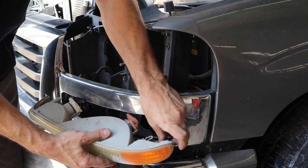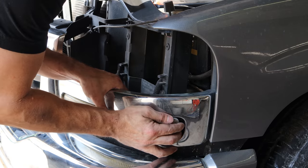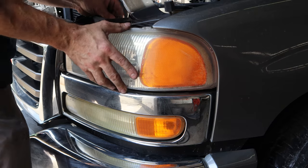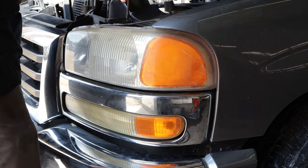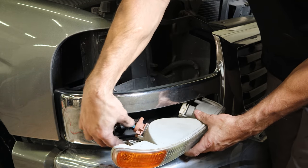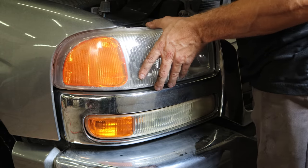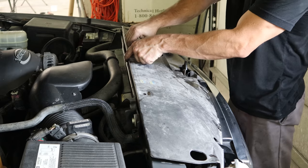The daytime running lights require two people to check, or a mirror, because if you set the parking brake the lights don't come on — they only come on when it's in drive and it's not dark out. So the only way to do it is to have somebody sitting in there with the car in drive. I guess if you're really fast you could check it yourself. I have a light-checking gnome to help me because I'm too old and slow to jump out of the truck, check them, and jump back in before it runs me over.